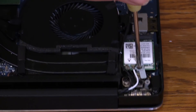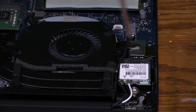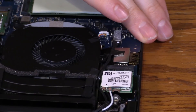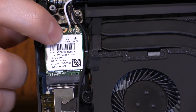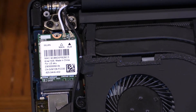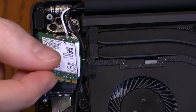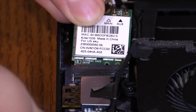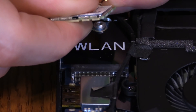We're going to undo this screw — I have to set this down so I don't drop it. Make sure you don't have any static electricity because you can fry a lot of stuff very easily. Here is the card. If you look, we've got the main power and the auxiliary connectors. These colors might not match what's on the Intel card — they're actually backwards — but just know that the main is always on one side and the auxiliary is always on the other. Pull the card out from the board, then take the two cords off and they should just pop off.